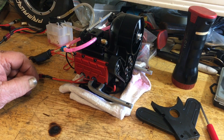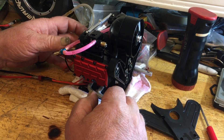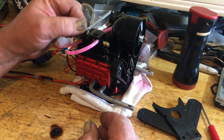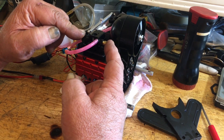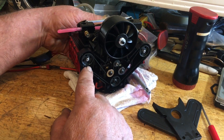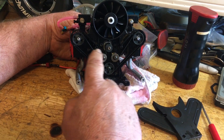Usually I get my engines and kits separately, but this one I wanted to do as a complete assembled unit. I've had a lot of questions from people saying they bought the complete unit and can't get it running. Now that I've ventured into this I can see why - carburetor settings around 5 on your low side, 6 on your high side. If you have any blow-by you'll need to tear it apart, check timing, and make sure the two dots are straight up.